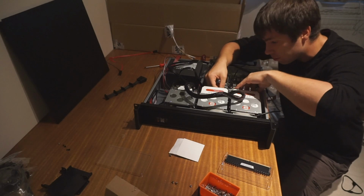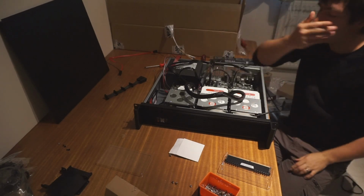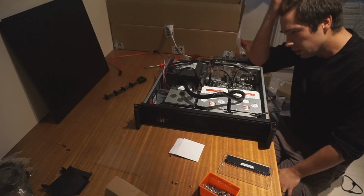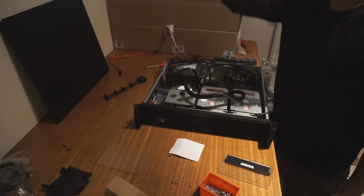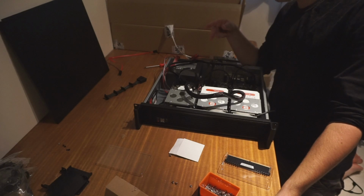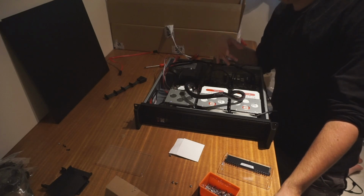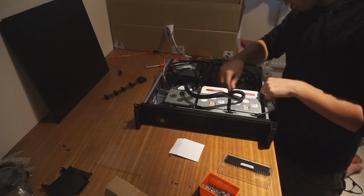Because of the layout of this motherboard, which I must admit was never intended to be used like this, I can only get 1 stick of RAM in with that bottom hard drive in. So what I'm probably going to have to do is put the 2 SSDs over here and not use the Raptor drive, and then do 1 SSD for cache and 1 SSD for that, unless I can find some other really ingenious mounting solution. So back to the drawing board again. Yippee!